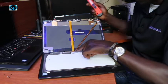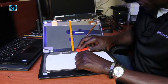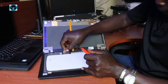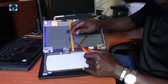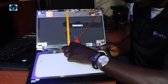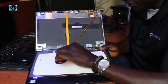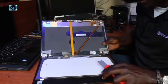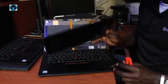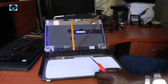The LCD connector is the one that connects from the motherboard to the screen. This connector is covered with a sealing tape which we need to gently remove. In most cases the tape can be hard to remove, so do it gently. Once you reach the connector area, you can unlock the connector using your pry tool and then gently disconnect the screen. This is the dead screen that is not working and we are going to replace it.